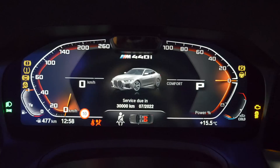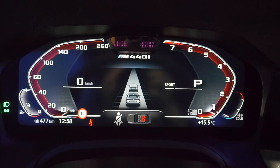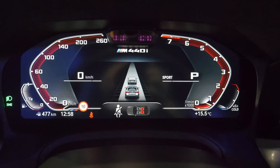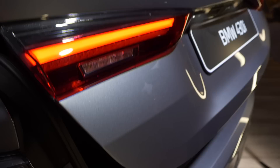The digital instruments look like this. When we turn on the engine, on the left side you see speed, and on the right side RPMs. It depends on the driving modes — comfort, Eco Pro with less throttle input, or sport mode where you can best see it. The RPMs go counterclockwise to leave space for assistant system information or GPS when you have a destination set. Head-up display is always a welcome option showing current speed, allowed speed, and GPS arrows if you have a destination set.